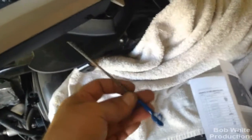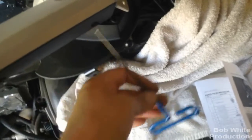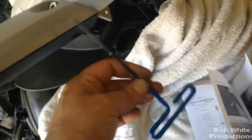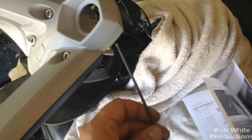I had to use an Allen wrench because the heads are too deep for a bit and drive tool to fit up in there, so I grabbed one of my trusty T-handles. It looks like it's a 3mm Allen wrench, so make sure you've got one to get those out.